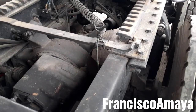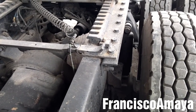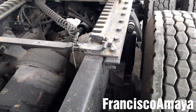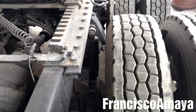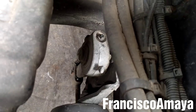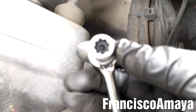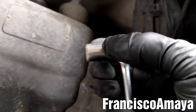Now I'm going to adjust the brakes. Three steps before adjusting: first, make sure the air tanks are at 100 PSI or more. Next, chock the wheels — make sure to chock the wheels before doing the brake adjustment, otherwise you could get run over by your own truck. This is the slack adjuster on this truck — it looks different than the Senko or other brands; this is a Meritor style. You'll need a 5/16 tool that looks like a star.